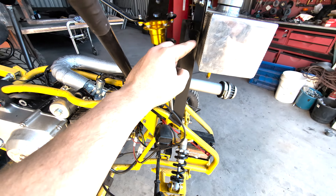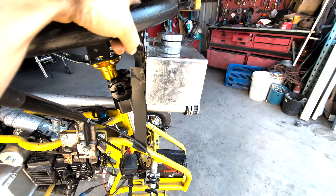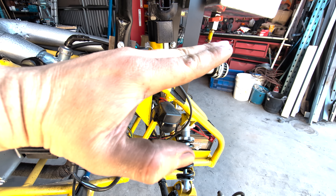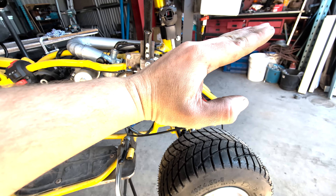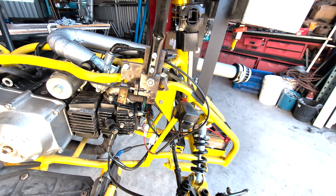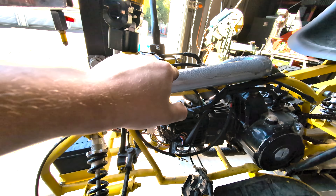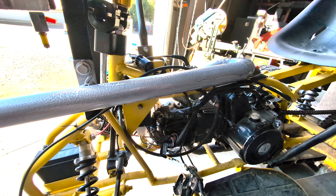I've lifted the fuel tank. Originally it was down here, but now it's all the way up as high as I can get without getting my hands in the way with the wheel. So hopefully now there's better flow down into the carb — you can see it's on that angle already, and the way I've got it on the fork it's already leaning forward. I won't know until next video though, because I have to order some fuel lines to go from the tank to the filter and then into the carb.